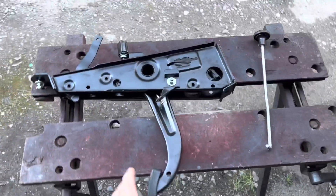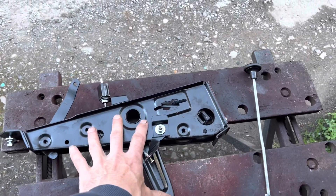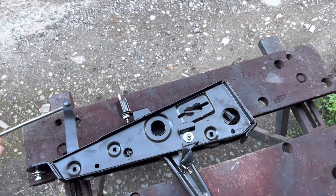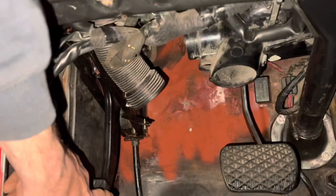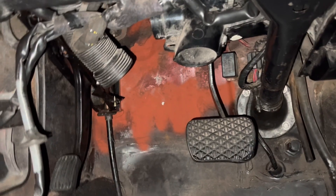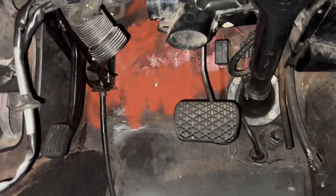In the left-hand drive 107 SLs they have a foot brake mechanism as opposed to a hand brake, and we've just got to tidy up that footwell, put this back in, and connect everything up — this has been refurbished in a previous video. Well, we finally got that brake pedal back in. All I can say is you can cancel your yoga lessons because it's really fiddly getting those nuts and bolts done up when you're upside down, and definitely a set of ratchet spanners helps.